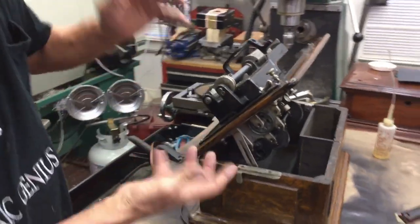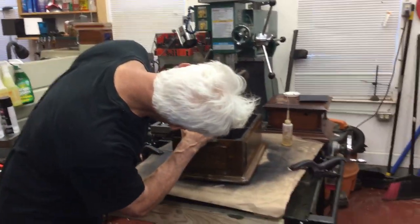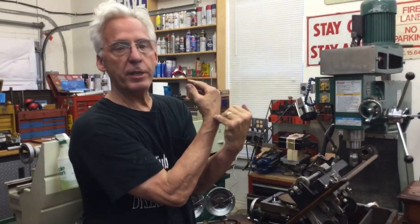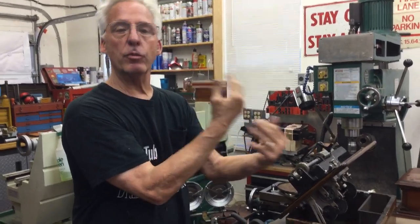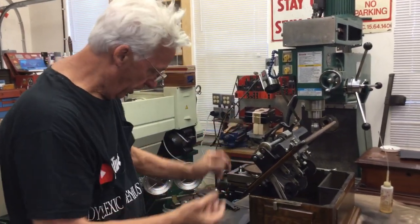If you're doing a home or standard machine and you have a tensioner pulley in here — here's the tensioner pulley and the belt coming up — you want it kind of pushing in a little. You don't want it tight; you want a little more slack so the tensioner can push into the belt. And that's how you set this up.